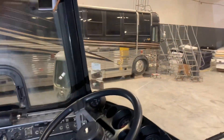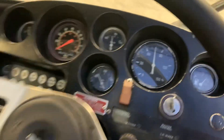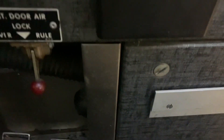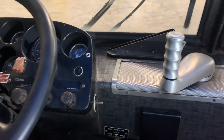I've got about 80 pounds left — you can see right there. This wiper here I can go ahead and park it and operate — nice smooth operation — and I turn it off and it parks itself. Now what does this side do? You can hear a clinking and it can't even park itself. What I found from rebuilding the other ones on the other buses is that the wiper motor is actually shot.